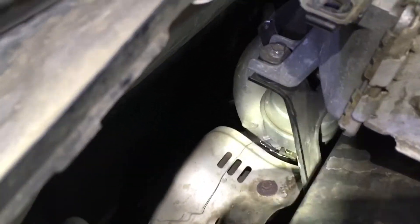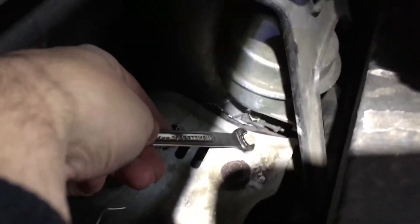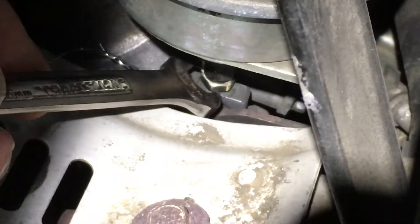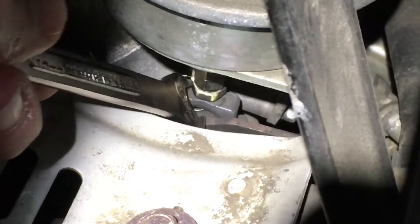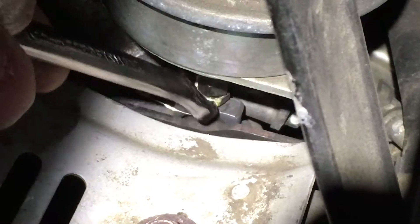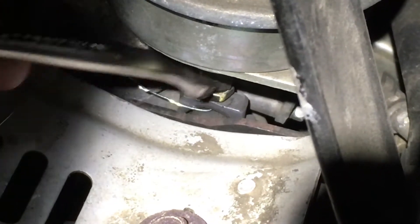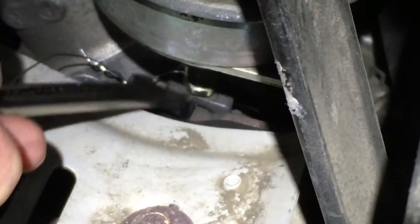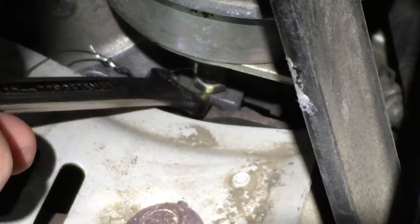They say patience and a couple wrenches, and maybe tying a string around the threaded part of the new part when it goes in. I may try to run a string through the worn gap in the old part to help pull it out, because otherwise you can drop it and it's tricky to find. I haven't yet found a need to take off the actual intercooler — the cover came off, it was just four bolts. We've wrapped a piece of wire through the gap so we don't lose this thing if it falls freely. The locking nut and collar are both 10 millimeter — I'm using a 10 millimeter wrench.